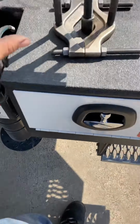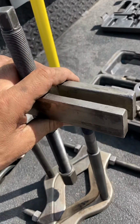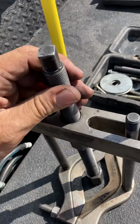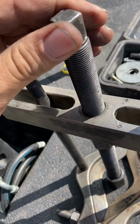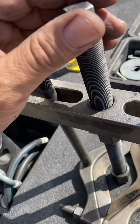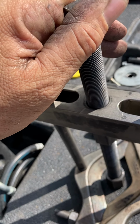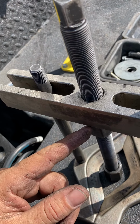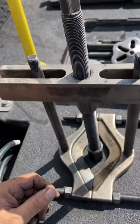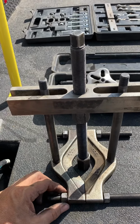But like I said, I decided to go ahead and make the video. And as you can tell, this puller right here, just look at it, it's different. But yeah, if you can get it in there, it also works as a yoke puller. And sometimes people want to turn this and hold this still. And for whatever reason, the mechanics, it doesn't work that way. You hold this still, and it doesn't take a lot to hold it still. This is where you put all your pressure, and it'll get it moving. Anyway, bearing splitter puller thing, something different.